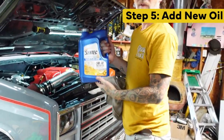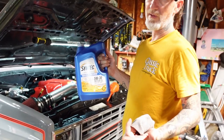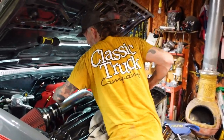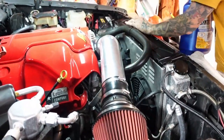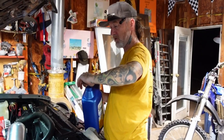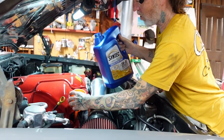The last thing we've got to do is fill our truck with our designated oil. Again, off the cap, I've got the 5W30, and I chose to do fully synthetic oil. You can do different types of oil — read your owner's manual to see what your car takes. In this particular motor it takes six quarts of oil. This big container has five quarts, and I've got an extra one there for the sixth, so we're going to fill it with all of the oil.